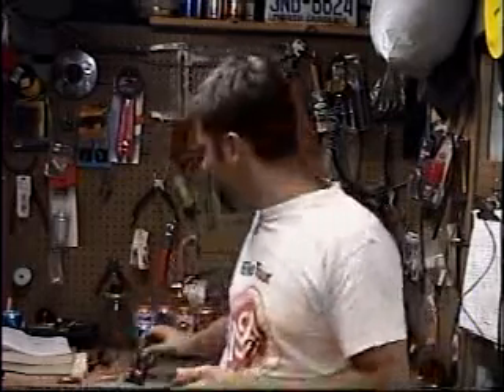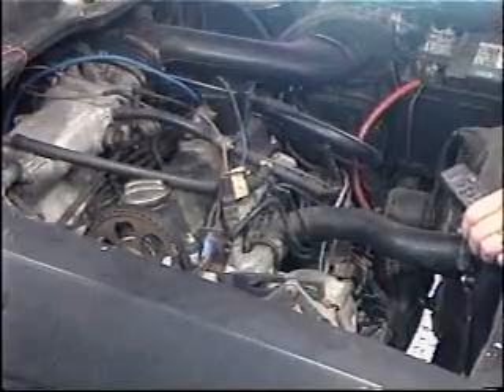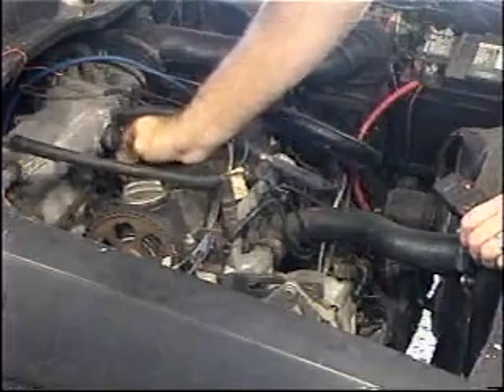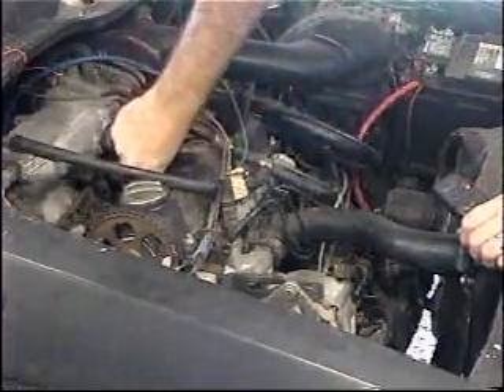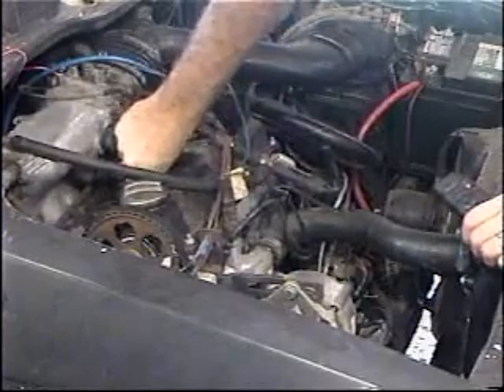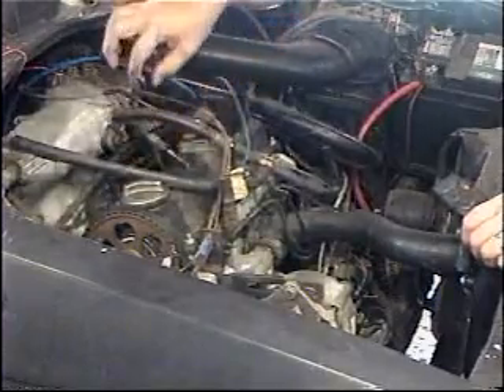Injectors need to be cleaned or replaced every once in a while. Getting them out of your car is a trick. If it's a new build and you've used new seals, no big issue — you pop that sucker out, give it a good grasp behind that intake manifold, and pop it out. I'll demonstrate for you — I've got the car right here. You want to reach in there, grab your injector firmly by the base, and just pull out on it. That's all there is to it. Out comes your injector with your seal — you kind of snake it out through there.